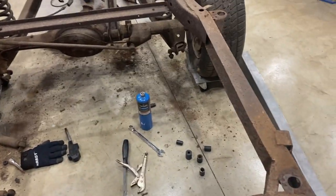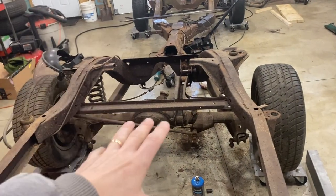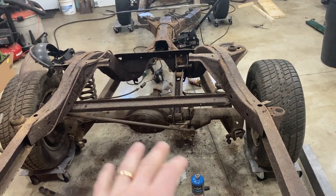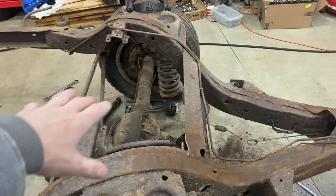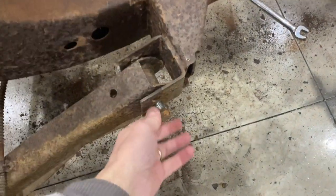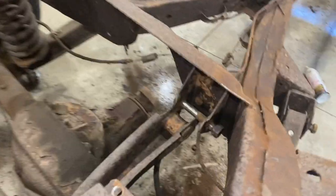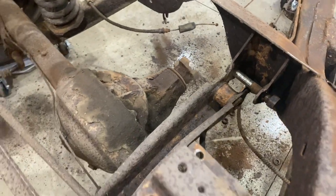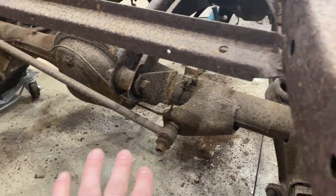That's kind of where we're at with the rear frame. I'm now going to pull the whole back of it apart, then pull the front of it apart. We're going to get the frame stripped down because I want to flip it over and see how rotted out the bottom is. Now, once you're on the back of the frame and you want to take the axle out, there are a few main points to remove. There's this point right here with a gigantic bolt in it. You've got to remove the shocks, which I already did. You've got to remove this bolt right here which holds the centering arm. Once you get the panhard bar out, this whole axle should drop out.